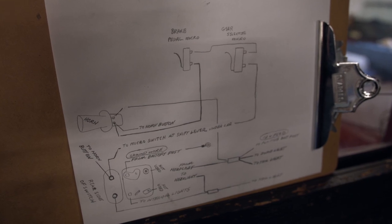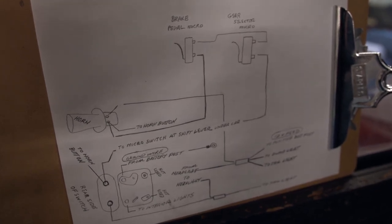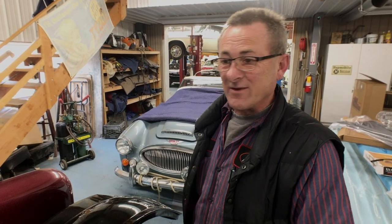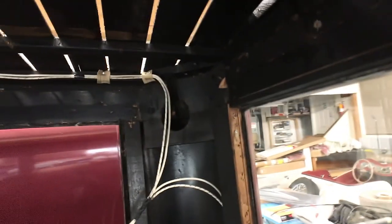I made a full wiring schematic of every wire in the car before I started taking it apart, because there's nothing to go by — no books to look at. If I ever want to go back, once I start making a few changes here and there, and want to see where a wire originally went, I can always look at my original drawings. Now it's all good.